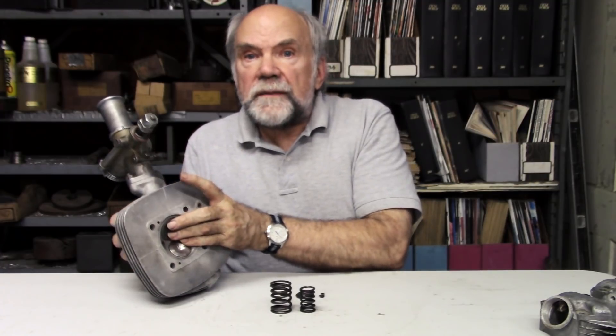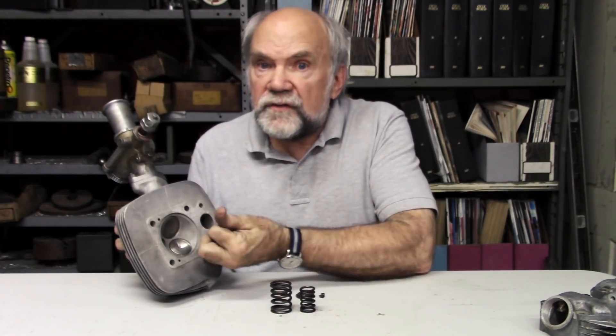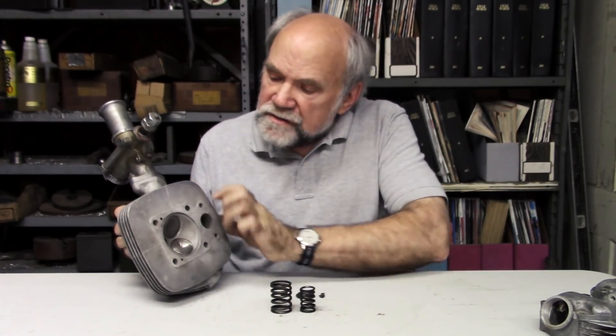You've probably heard about the value of fast combustion. The value of fast combustion is real, because the longer you have flame going on in this chamber, the more heat is being driven into the cylinder head and into the crown of the piston, from which it is lost — it's not there anymore to push the crankshaft round and round. So designers take care to make the combustion process as fast as they can.